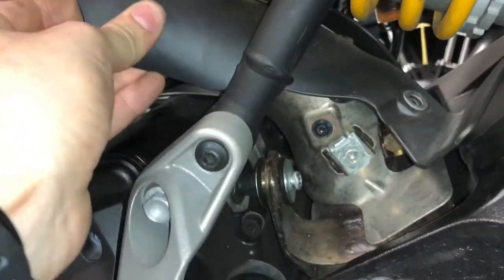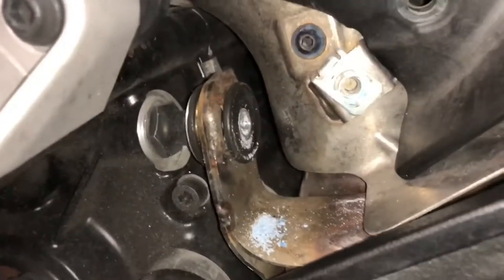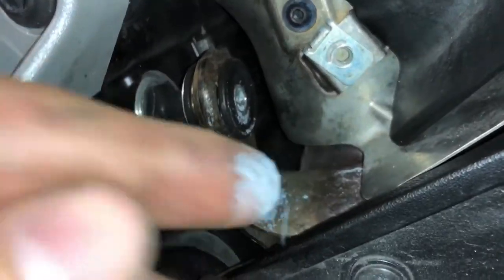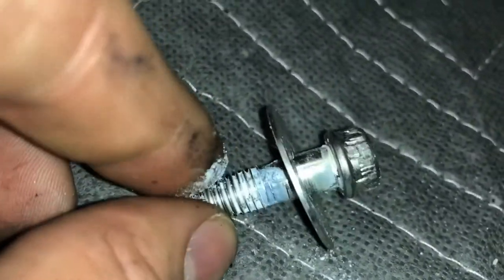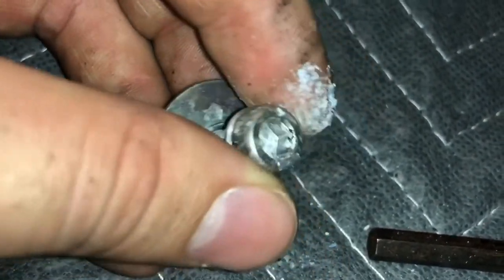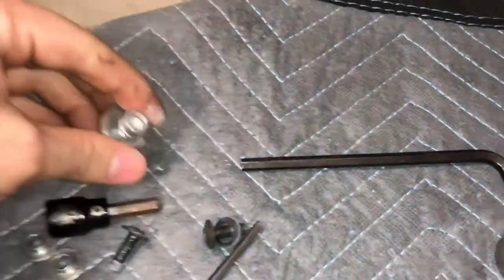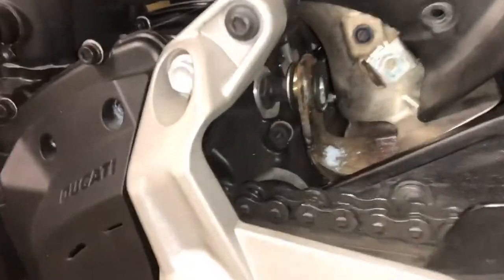You can't fully take it off — you can slide it out of the way, set it up there, and that'll give us access to this bolt in there. I went ahead and removed that bolt — you can see the Loctite that fell down in there. Get a good pair of channel locks and grip it on those little grooves — you should be able to break that Loctite — then find an allen key or a socketed hex head to get in there.